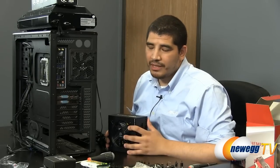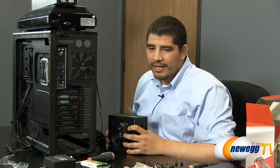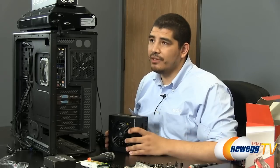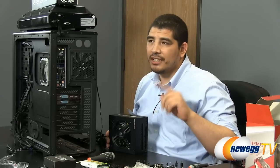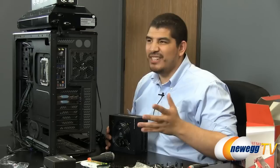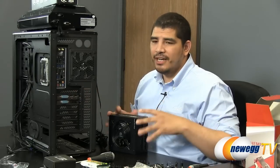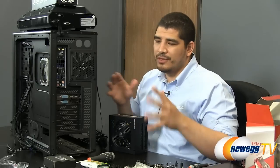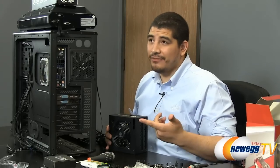But I've been really happy with actually trying out our VG monitors that have the 120 and 144. It is a noticeable differential, having so much faster response from the panel, because when you move your mouse and track back and forth, you start clicking on windows, you just get this really clean response from the system. And that is kind of addictive, because right now in the office I have 6 test beds, and 2 of them have high refresh rate monitors, and I notice it all the time when I go back and forth. But unless you have multiple monitors at home, you probably won't notice that difference.